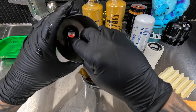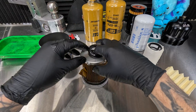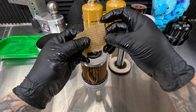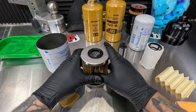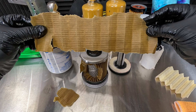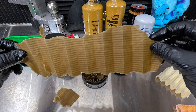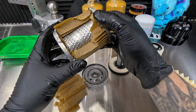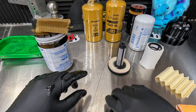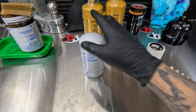I guess that's what separates the water out — it rests in the bottom right inside here for the drain. So that's where it's critical that your water and fuel sensor sits at the proper level down at the very bottom of these filters. It's just a paper material. You can see some stuff in there but really not seeing anything at all. Well, boring is good because we really don't want to find anything, but we also want to see something to confirm it's capturing everything. Let's move on to the actual fuel filter itself and cut this one open.